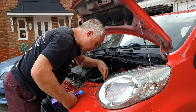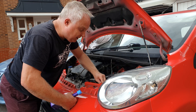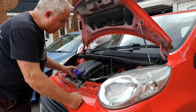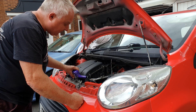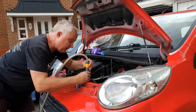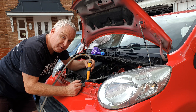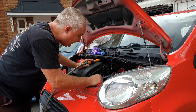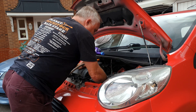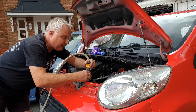Making sure that you've replaced all your hoses, put back all your clips, closed all your drain cocks, and replaced any suspect hose clips. First I'm going to pour the cleaner into the top of the radiator to make sure I get all of it in, and then gently fill with water. I'm filling with tap water for the cleaning process, but when I do the final fill with coolant I'll use deionized water. When you think you've got it nearly full, give some of the hoses a vigorous squeeze to see if you can push any air out, and if you hear any air gurgling out, wait until that finishes and then fill some more.